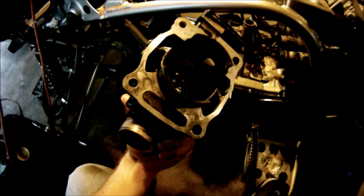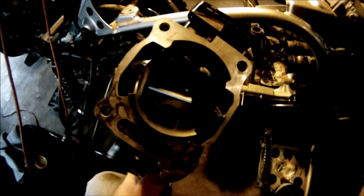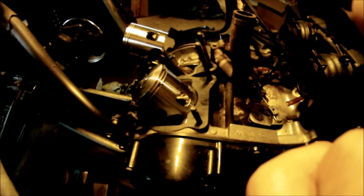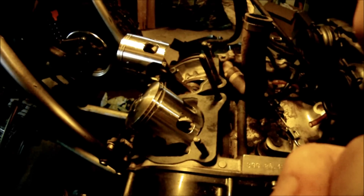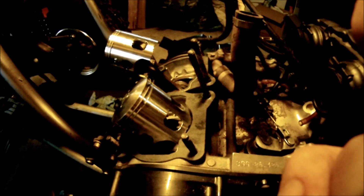Now I'm going to put a thin coating of oil on the inside of the cylinder. Make sure it was completely dried before you install it — if you have an air compressor, blow it out first. Then put a thin coating of oil on everything that's going to be on the inside of the engine, even a little bit on the intake and exhaust. Triple check that you have those clips in place, piston rings in place and marked where they should be. Make sure the inside of the cylinder is greased and then go ahead and slide the two together.